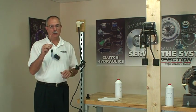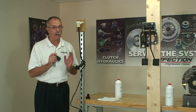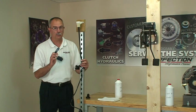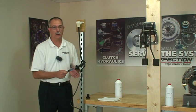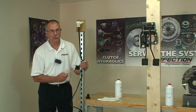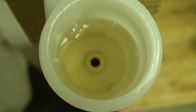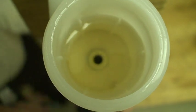Now how do you bleed it from here? This is the only tool we're going to use — a Phillips screwdriver. Don't take your new pushrod and lock it in right now because that'll make it very, very difficult later on to install it in the vehicle. To make this system work, two techniques we're going to employ: tapping on the line with the end of the screwdriver, starting from the bottom, working our way up; and we're going to take the screwdriver, insert it into the piston — there's a spot where it'll go, just like the pushrod — and then just short strokes. You don't have to push it far, you don't have to push it real hard, just back and forth. Tap on the line. This allows the air bubbles to come out and the fluid to go back down in. This will take just a few minutes and it'll be all bled out.